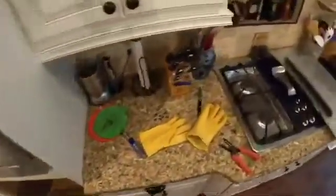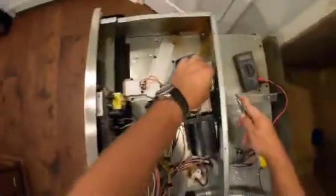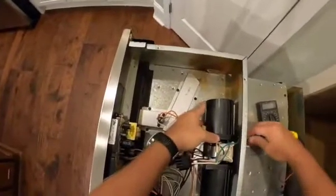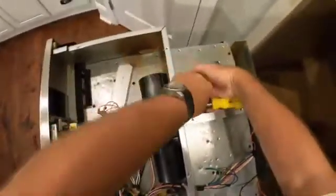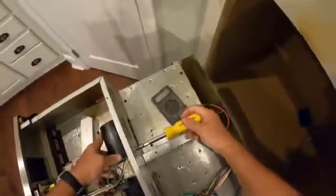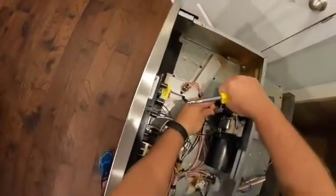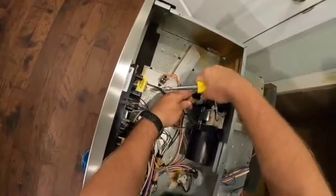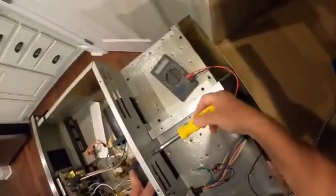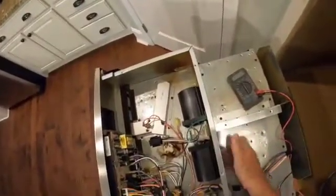So let me grab a mounting screw. Make sure that we're in the ballpark there. We are. Okay, so we've now got that properly installed. So that's grounded appropriately. We will put these other screws in, and then we're just going to simply plug in our harness right here. And you want to just make sure that when you're mounting this up, that the vents match up to the holes here. So, and you want to make sure these spin freely as well.